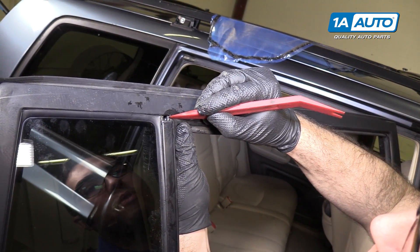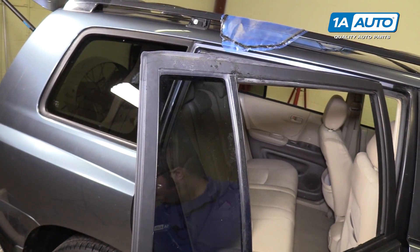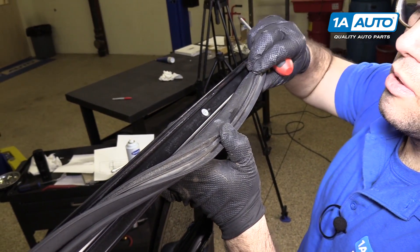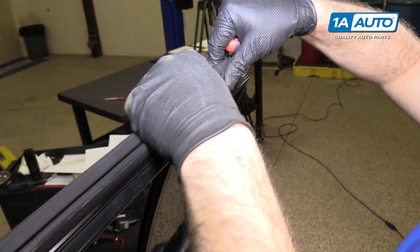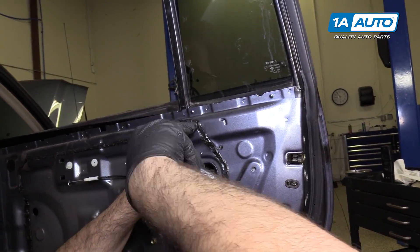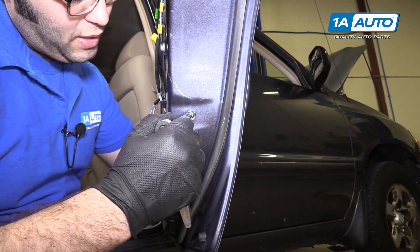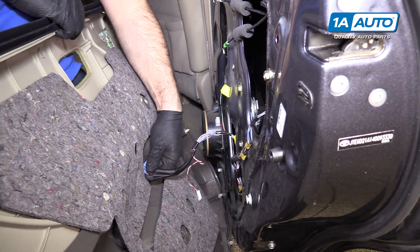This guide needs to go up. I'm gonna reinstall the small Phillips head screw at the top — just go until it's just tight and then stop. Push the door gasket back in place. Reinstall the upper bolt, then reinstall the lower one — you might have to reach in with one hand to move it over so it lines up. Get it started and tighten it up. Plug the window back in and try it before we button this all back up.